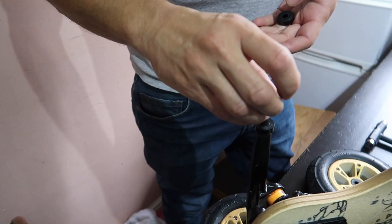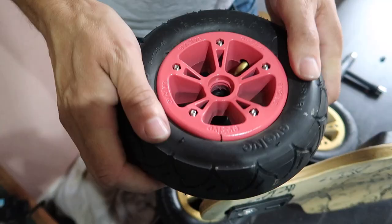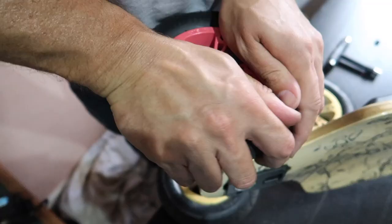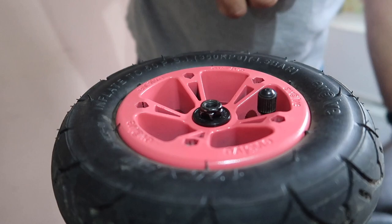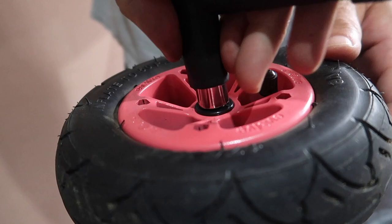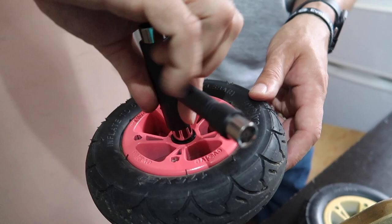Putting the bearings back on, so you put the bearing in, spacer on. They are quite tight because of the paint. And if you use your nut, gently tighten it and pull the bearings into place. Just do it till it stops, don't over tighten it.